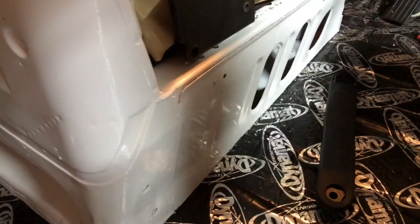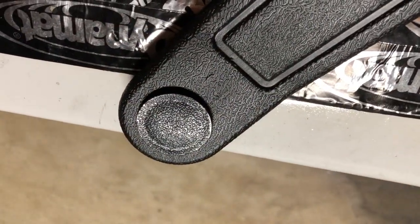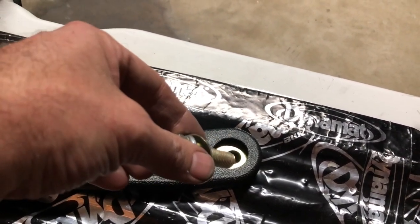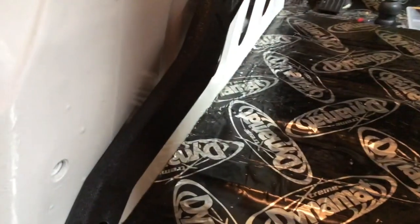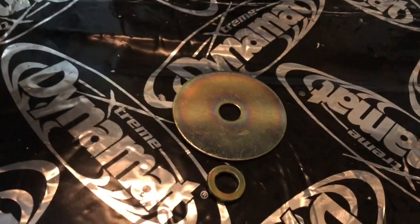So that's on. Now we're gonna move over to installing that retractor — we're gonna put it on this seat right here. The first thing you're gonna want to do to install this is to take that black cap off. Then you're gonna take the long bolt and put a lock washer and a washer on it and feed it through — feed this through that hole and then screw it into that factory screw hole thing. That is installed to the side of the driver's seat; I've already done this side — that's the passenger side, it's locked into place. So then the next thing you're gonna do is again reinforcement with one of these giant deals, a locking washer and a regular washer.